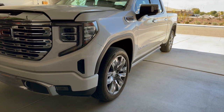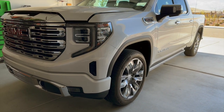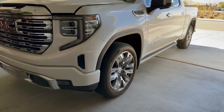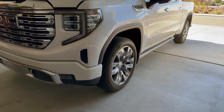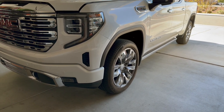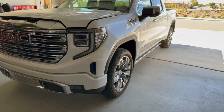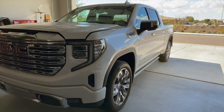I'm going to start with the fronts. We will have to compress the struts, which are probably a little harder than the rears. Let's go over the tools. You want to make sure you're on a level surface with a good jack and a couple pairs of jack stands so you're safe. Jacking up the front suspension, you'll need access through the top above the hood to get the top strut bolts.